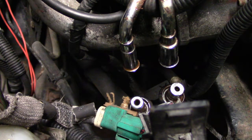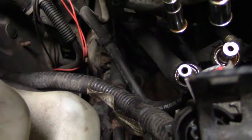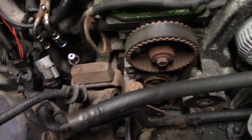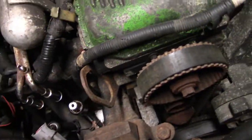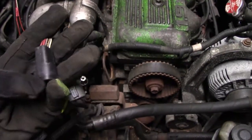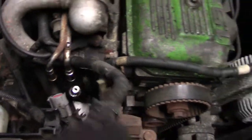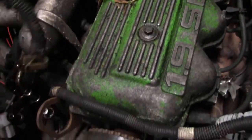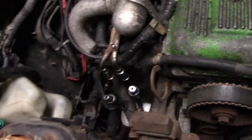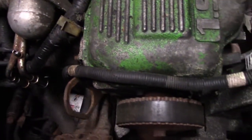Other things I disconnected: the rear O2 sensor — that's the green wire down here. The main harness. These two lines — one's for the fuel injectors, the other goes to the oil pressure sensor and a couple other odd sensors. Usually I just put them out of the way — tuck the engine harness from the engine bay over, same thing with the fuel lines, tuck them out of the way so they don't get caught while pulling on the engine.